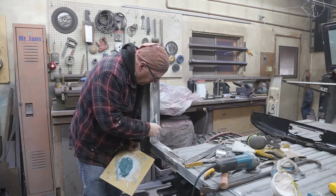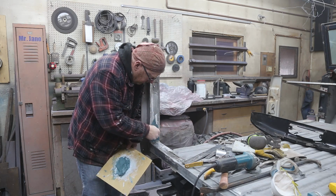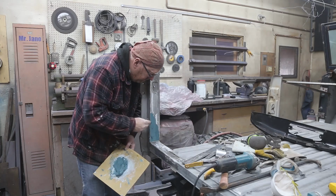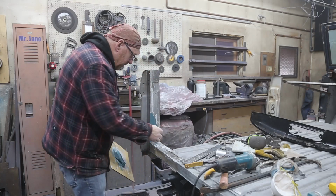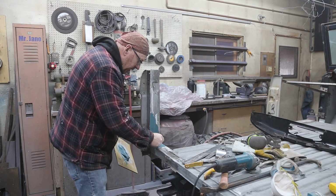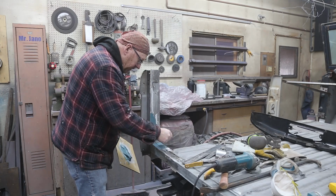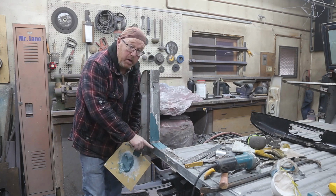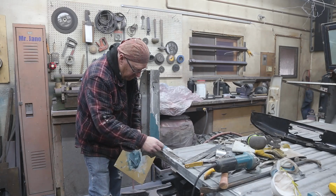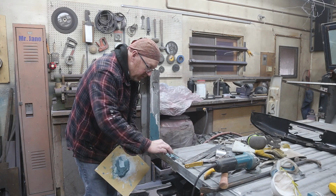We gotta get some filler on here. So where it's all been welded down in here, I'm gonna put a fiberglass reinforced filler in first, and that's okay. It's a little bit tougher than your regular filler. Especially if you're doing these curved edges down here, you know, a little nicer, because then you've got something a little tougher to make that radius. If that makes any sense.